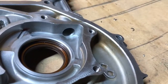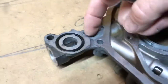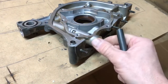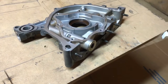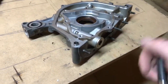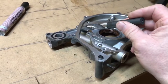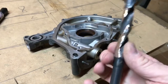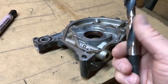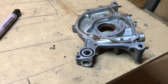I haven't touched this area yet — I'm going to go through and round all the edges afterward, smooth it out, and then round out the inside edges of all this area. Everybody knows the little trick about the shim, but I'm actually going to put in the proper washer underneath it. I know you can make a washer out of a ring terminal like everybody else does, but I'll just drop by my local hardware store, take the spring out, take the cap off, and get the proper washer. Again, 5/8 is the proper size — I think 9/16 is the passenger side. The best insurance policy you'll buy is a $20 drill bit that you grind down custom so you don't screw up a two-hundred-dollar oil pump. If those threads get caught, it's a trash-can oil pump.